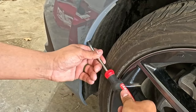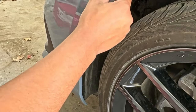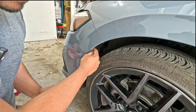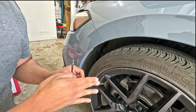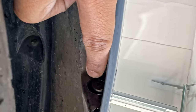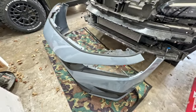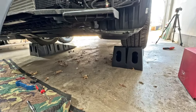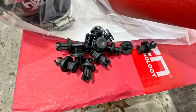Okay, we got our Phillips here. I released that. Typically there's one more screw right in here that connects both of these, and typically you've got to pull the lining back. It looks like there's one more Phillips screw hiding right there — let's go ahead and unscrew that. So as you can see, I successfully removed the bumper. There's a bunch of clips that you have to undo underneath the car. I just put my car on the ramps so it gave me easier access to get underneath and get all these clips out.